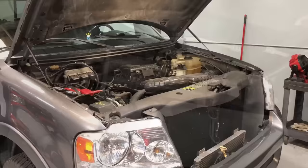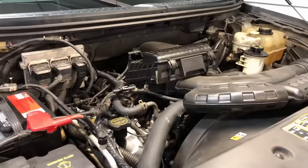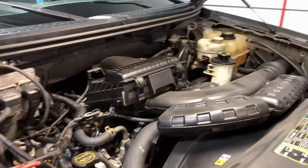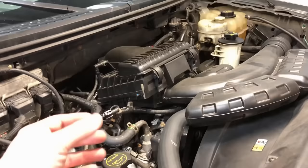Let's go up top and talk about a few things like the cooling system and spark plugs that affect all Ford vehicles. Spark plugs on a regular naturally aspirated engine — like this 5.4 three-valve, anything non-EcoBoost — you want to change spark plugs every 60,000 to 80,000 miles.